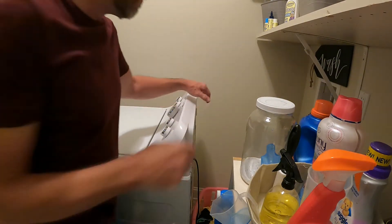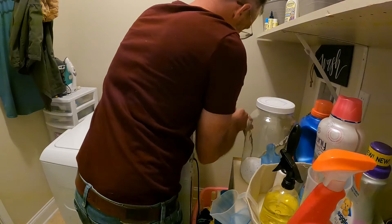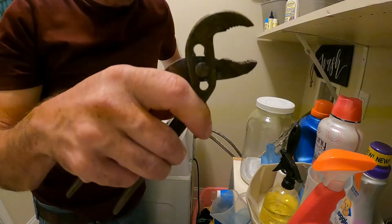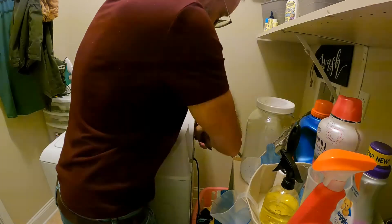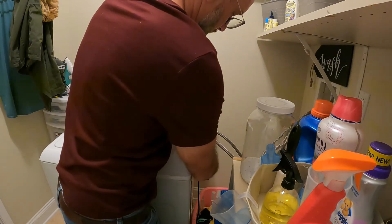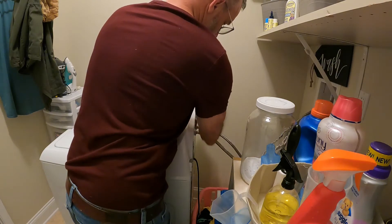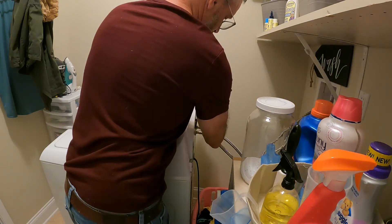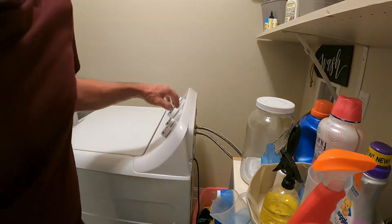Red is hot, so put that hose back on the right connection. You can get a pair of nice wrenches — I don't want to over-tighten any of this because it's got rubber seals and it's plastic, so don't get too aggressive on there. You do want to check it for leakage once you tighten it up, but when it comes to that point where it stops, you want to quit.